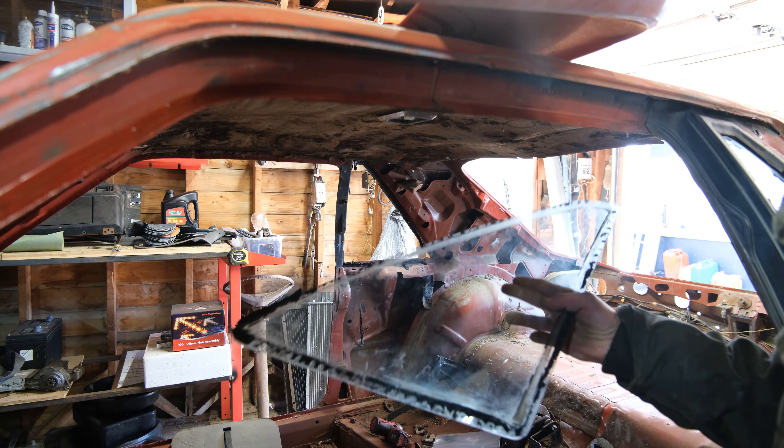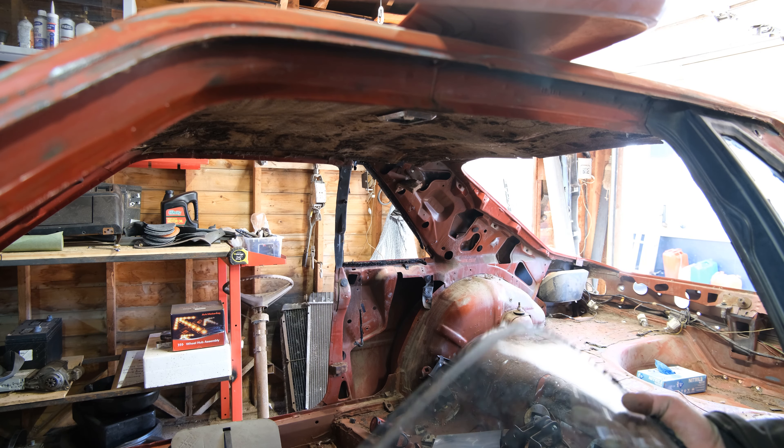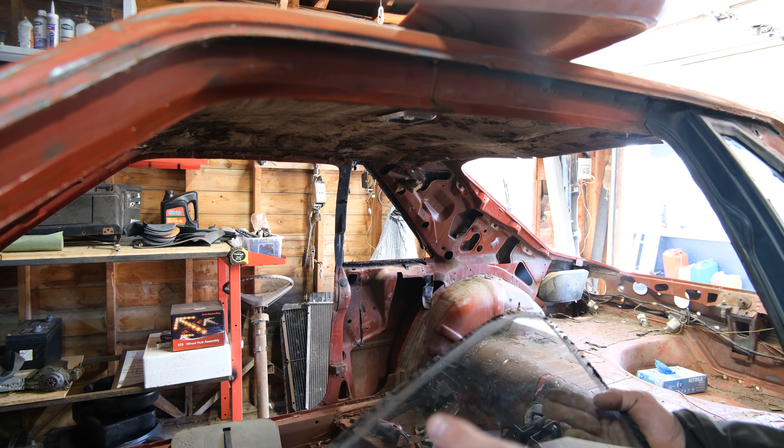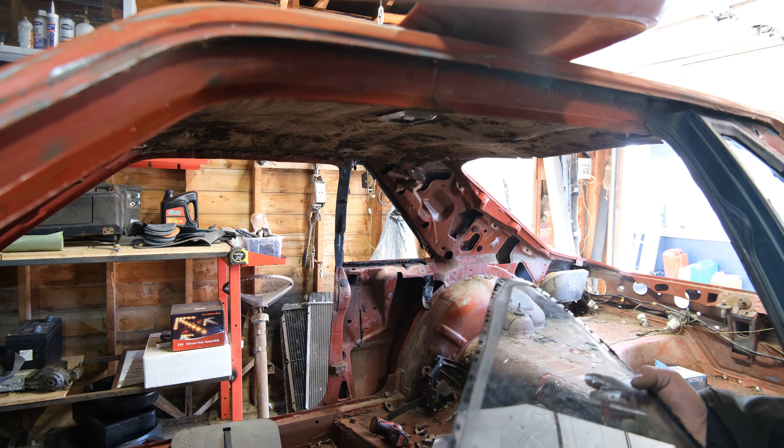That's out — and there it is. You need to be very patient with these because if you have an '85, '86 or anything older, they don't make this glass anymore. It's tempered and it's very easy to break, so be pretty delicate with these. Then we're going to clean all that butyl up. What I'm going to do when I get those out is mask the inside so that I can spray the outside of the car. I need to do a bunch of body work and I didn't want these in the way.